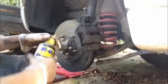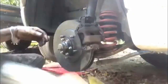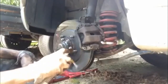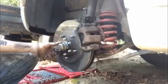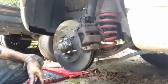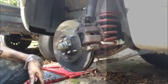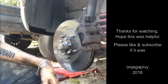The brake cleaning spray — it sprays on and you can use it to clean brake components while it's all assembled. Then you just let it air dry and it evaporates off. You can see it dissolving the stuff off. I'll let that air dry before putting the tire back on. I want to put the hub cover back on as well. That's how you change your rotors and pads on this particular Suzuki model. Thanks for watching.